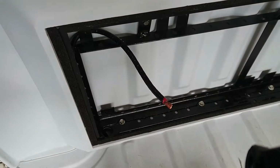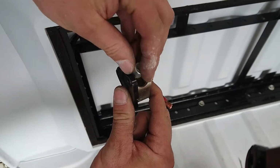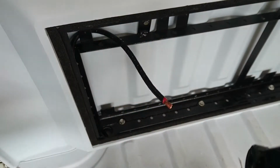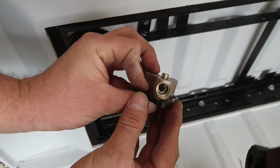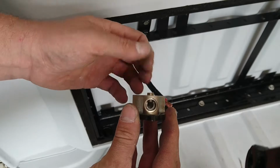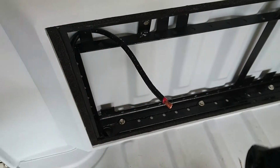All too often I find myself building stuff with leftover rollerblade parts. This is a bearing spacer, 8mm inside, and as you can see, it doesn't fit in there. Won't fit. It's about the same size. So what I did is I crushed it a little bit, cut the top out, and now I have a collar, so this nut will drop down in through it, that gap, and crush the wire, and I can use it. This is made out of aluminium, so it's a fairly decent conductor.